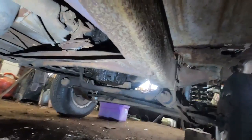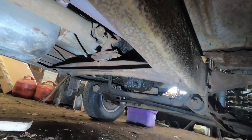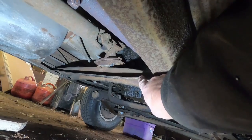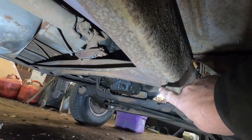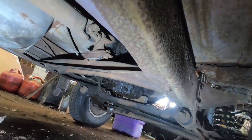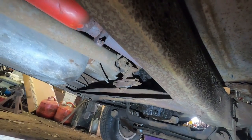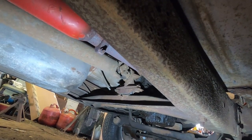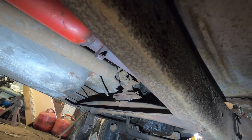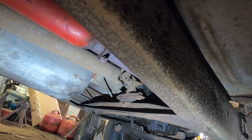I hope this is showing up on video, but the rear mount for the new transmission — I expect it to be a really straightforward, easy thing. This is the crossmember. I think all I'll have to do is move it back a couple of inches and drill a couple of new holes in the frame. I believe that's all I have to do with that. The driveshaft I'm not sure about yet. I need to get the old transmission out and do some measuring. I'll let you know in the next video what I find out.